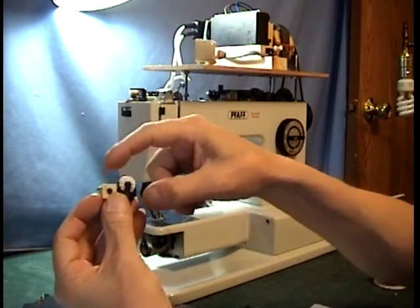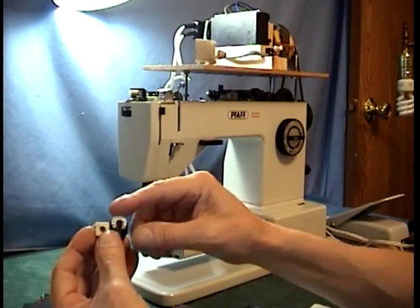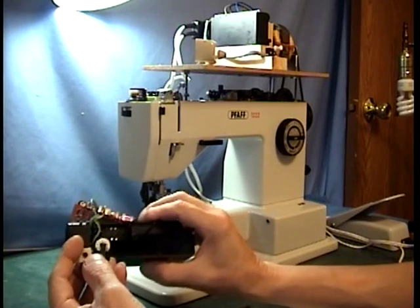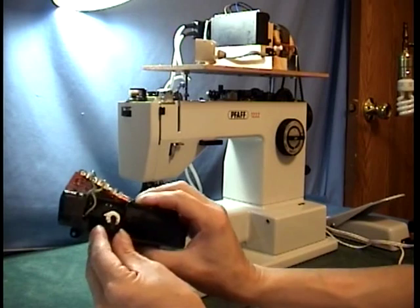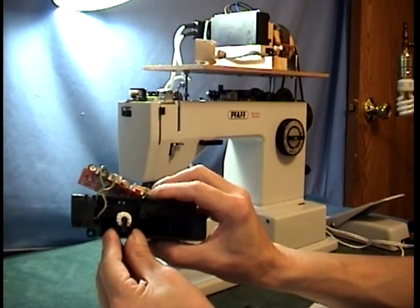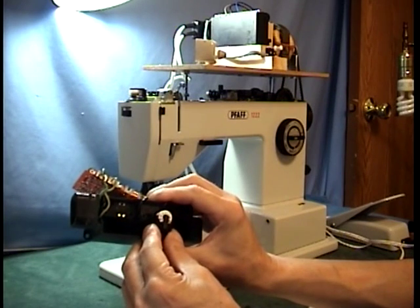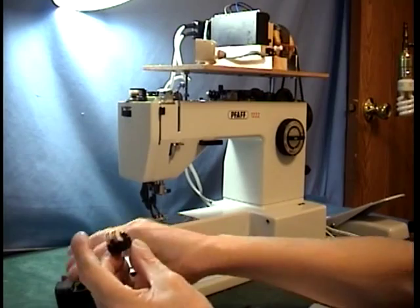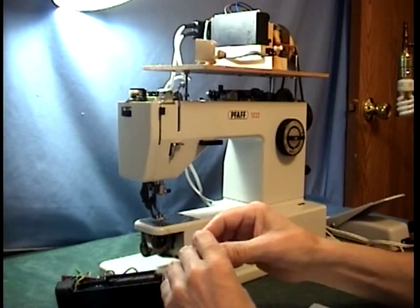The height of the available replacement coils is a problem — trying to fit them into this little box won't work. You can see the little box; it's much bigger and would cut into the switch. Even putting it on the other side, it's too big for the box. Plus I can't get the right microhenry value in that size.